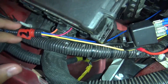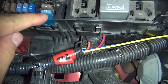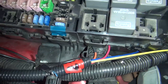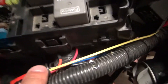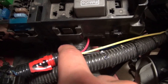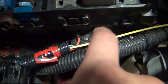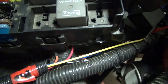In this wire loom you'll have four wires: red, yellow, blue, and orange. The orange and red wires go to this 15 amp fuse right here where the blue tape is. According to N2MB's install guide on their website, the orange specifically goes into the fuse side and the red goes into the end of the wiring harness for the ECU.